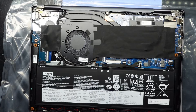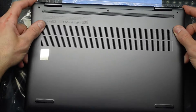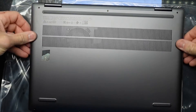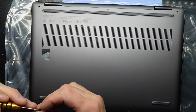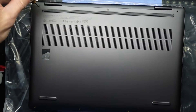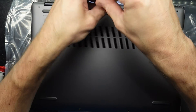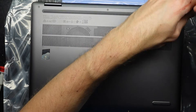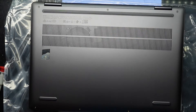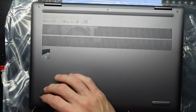RAM is not upgradeable or changeable. Then this should slot in and under — push it down, push it together. Put those T4 screws back in; big ones go near the back near the hinge, small ones go near the front. And I hope that helps upgrading your NVMe drive in your Yoga 7 14ARP8. I'll finish putting these screws back in and I'll see you guys later. Bye!